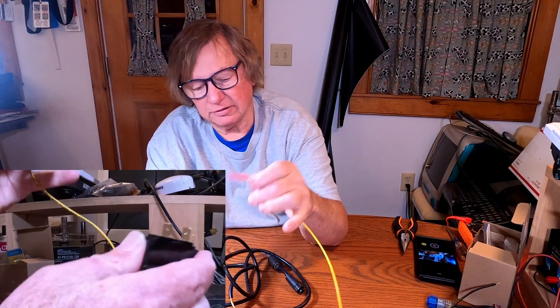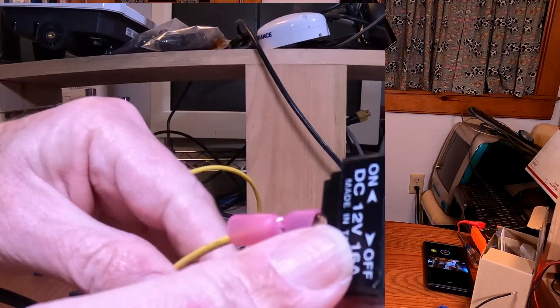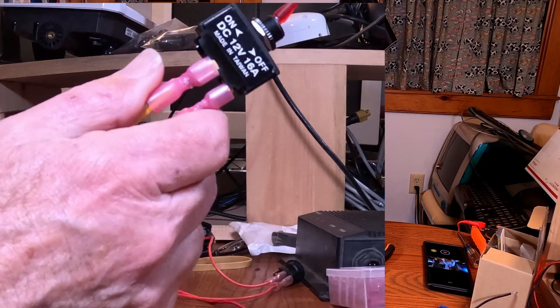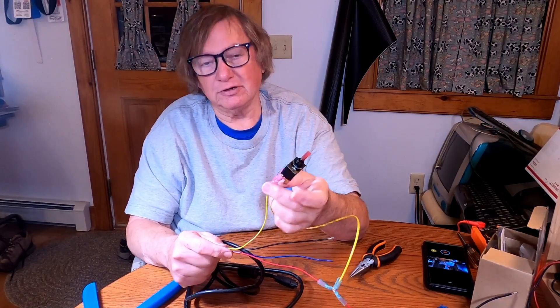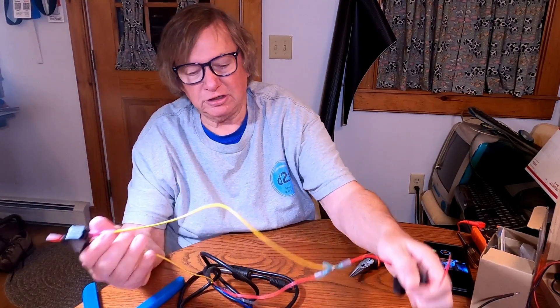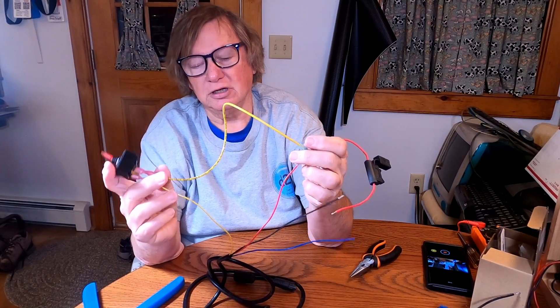These two wires are ready to go and get connected to the switch. I'm going to connect the main wire to the common, which is the one in the middle here, because that connects directly to power. Usually you have the switch connections on the outside of this connector. I had an issue with the wire falling out and I'm not using my best connectors for this example — normally I would use the Ancor connectors like I've shown in other videos. But in this one I'm simply using the inexpensive ones from Amazon just to show, because for a real installation I'd make sure I figured out the right wire lengths and not have too much hanging around the boat. So at this point we've got our initial circuit done — we've got power going to the switch, going to the yellow wire, which is the important part on controlling the module itself. This is the red wire to power up the module, and this is the ground wire.